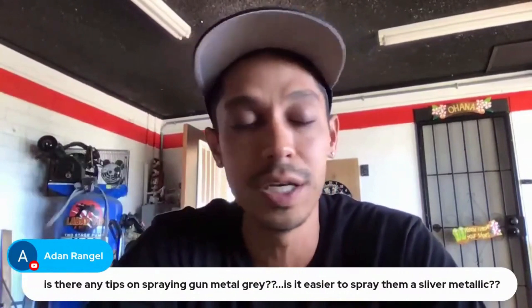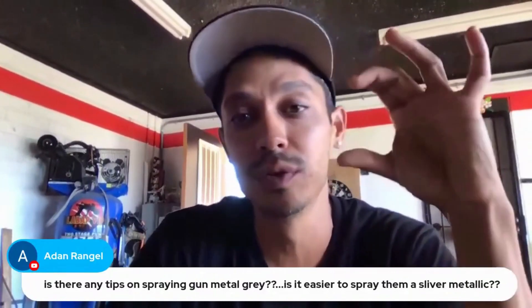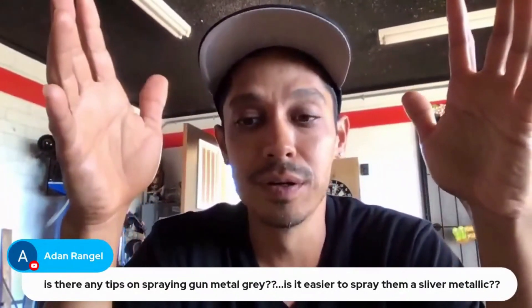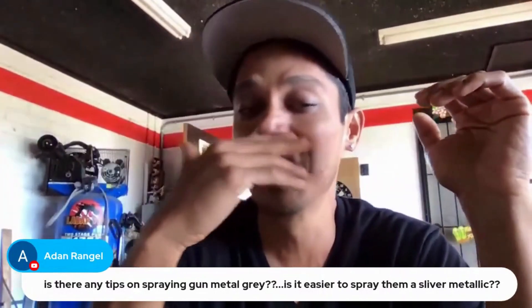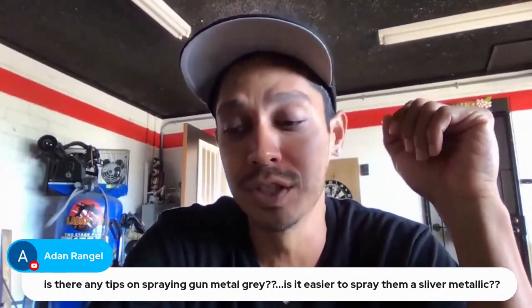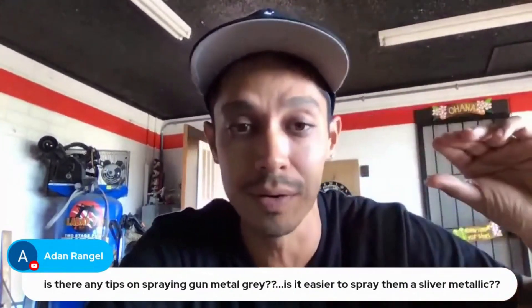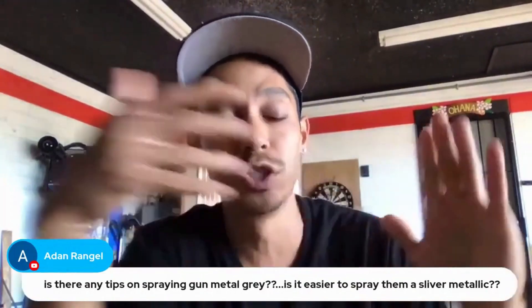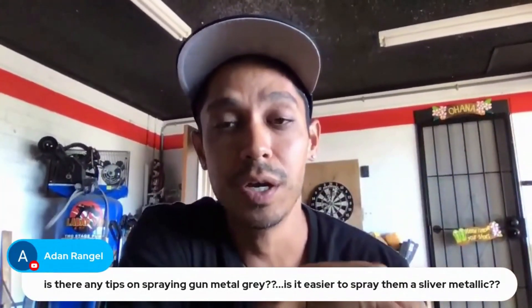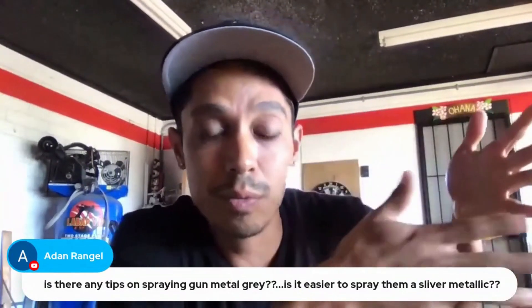After you paint, make sure you take your gun apart — not every nut and bolt, mainly your fluid tip, your needle, that whole area — and clean it really well. As long as you keep your guns clean, they should spray well. When spraying any type of metallics or flakes, a dirty or malfunctioning gun that's not properly atomizing will give you heavy spray at the top, bottom, or middle. The key is even distribution of paint material hitting the panel. An incorrect fan pattern overlay will give you an issue as well.